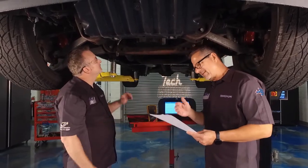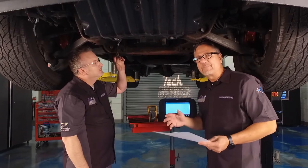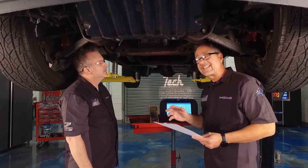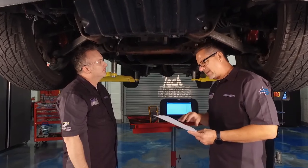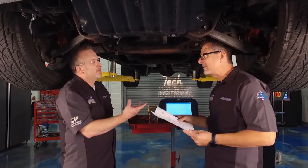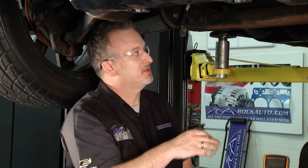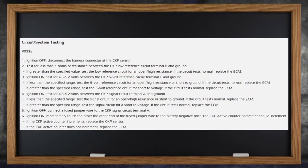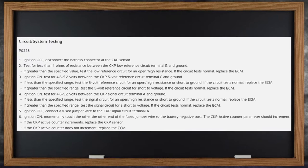What if we didn't have the right wires? If you don't have the right wires or the right schematic, back up and punt. Don't just go in there and start poking wires — you can short a computer, you could do a lot of damage. Just get the right schematic and figure out what's going on with your wire harness. There are so many electronics in today's car. Don't poke if you don't know what you're poking.